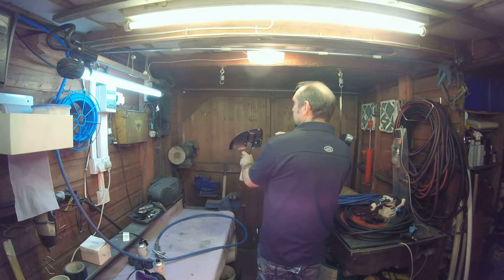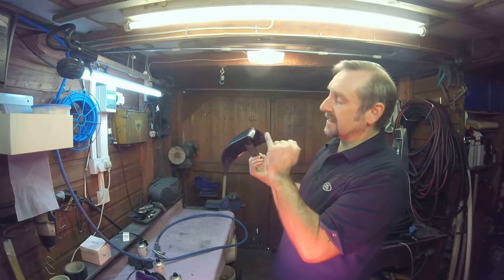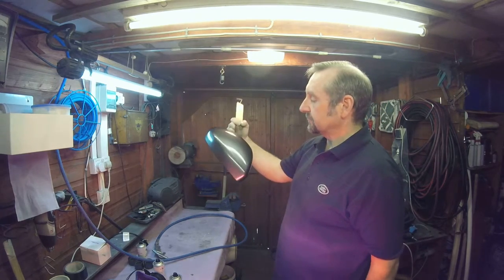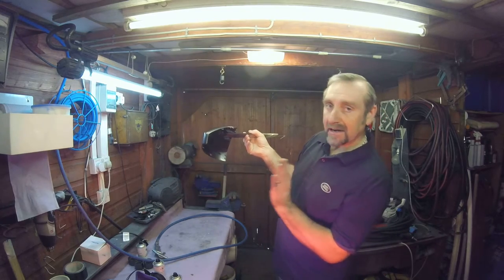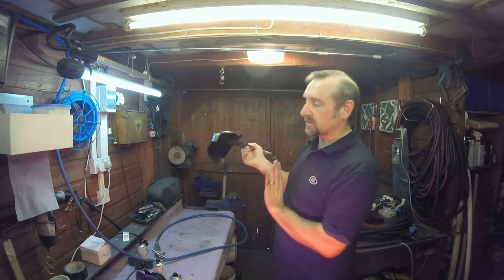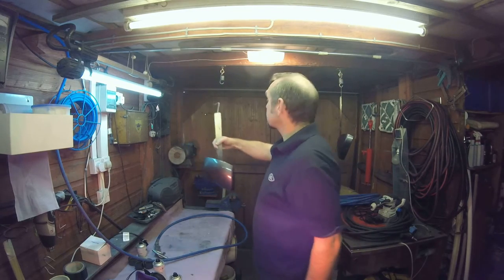Once again, you're never too late to put something right. Don't think it might have covered and you've got an issue. I thought that I could see a little bit of darker grey through that tip. So once again, dust it in. And I sprayed from the back, so that I didn't get wet paint over an area that's already flashing off. That's good. That's done. That's the base coat done.